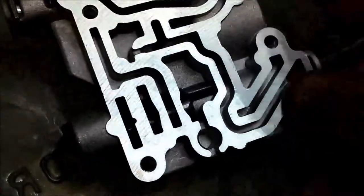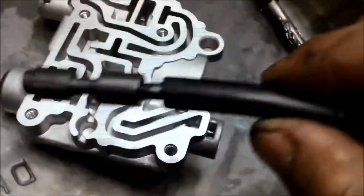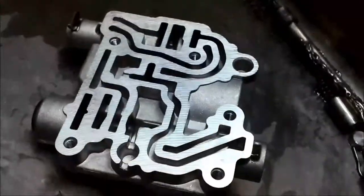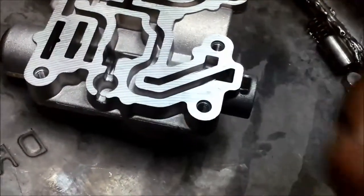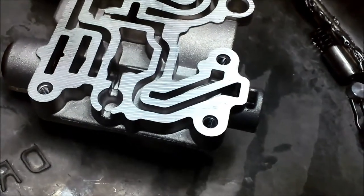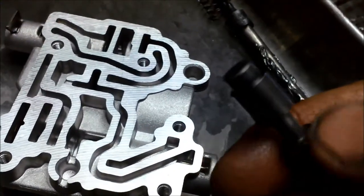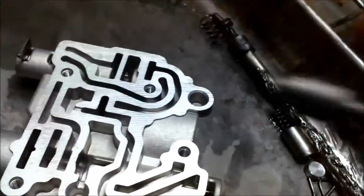With that rubber tube, it's quite sticky in there, so I'm going to have to do it with two hands. I'll put a little rubber tube on the end just so I can shuttle it through the bore and work it through nicely. This is actually a metal valve, so they're not anodized like the other ones, so these are prone to getting little burrs or edges that come off. I found that the ones with a nice sharp edge seem to have a cleaning effect as it works through the bore.